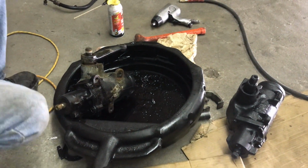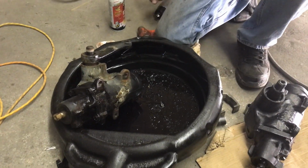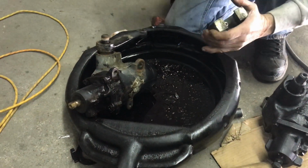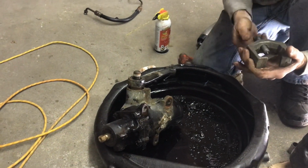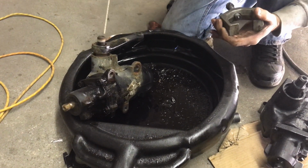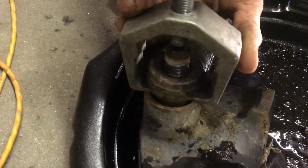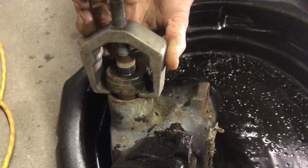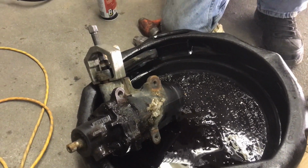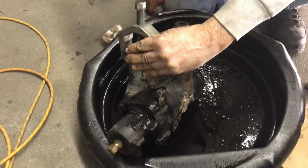All right, anyway, I'm gonna show you how to get the Pitman arm off. Either way, we gotta bring them a core back, so, you know, they ain't getting that one. No. So, Pitman arm puller. No, I mean, we gotta bring this one anyway, so. All right, put a little doodad on that. So you can see there's a little pinhole, like a guide hole. Right? So now we know it. 2 turns, the flat. This is pointing basically straight back.